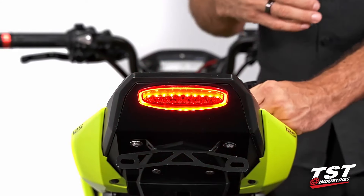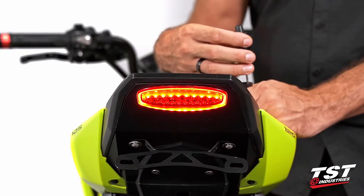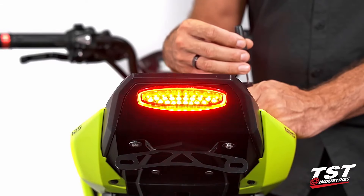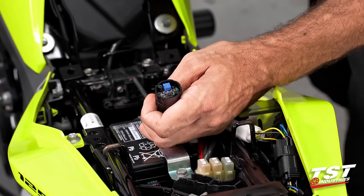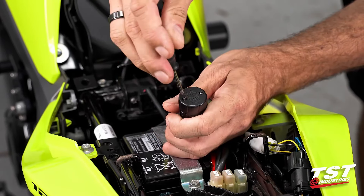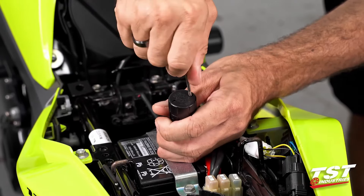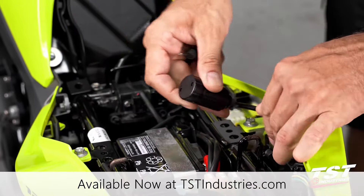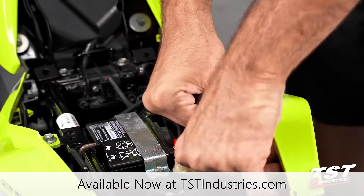For Intermittent Pulsar mode, I prefer it somewhere close to the top of the range to make it the most visible — but freedom means choice, the decision is ultimately up to you. Once you're done with your adjustments across all modes and rates, replace the cap and turn the screws back in. Replace the brake light modulator in the location you chose to mount it, and you're good to go.